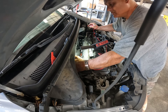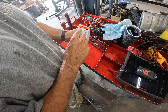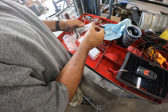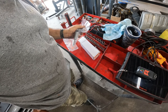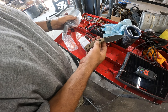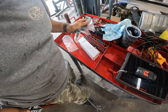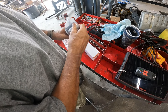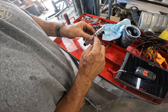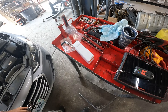Let me get some parts ordered, let the engine cool down, and I'll show you what it looks like. We just got the part in — it's a Dorman number 918-033, held on with one 10mm bolt. This is what it looks like right here. A lot of times they get gummed up inside and this valve will stick and not operate correctly. Let's get it on the car.